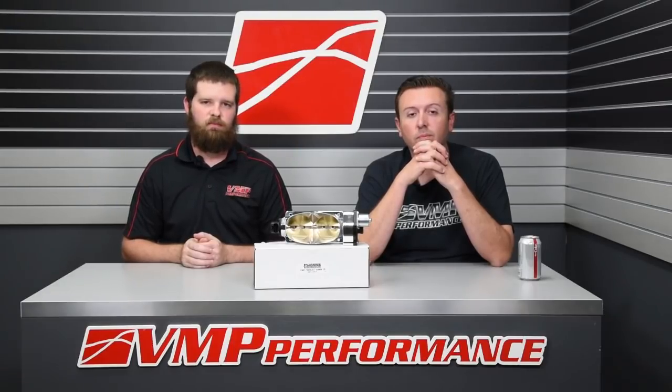Any chance a VMP 2650 will adapt to the GT350 anytime in the future? I think we hit this last week. You can buy our supercharger kit and put it on a GT350. I think the only thing you'd really have to do is make sure that it A, clears the hood with drop engine mounts, and B, drill a hole in the fuel rail and tap it for the GT350's fuel rail pressure sensor. I think other than that, it should drop on.